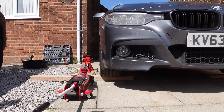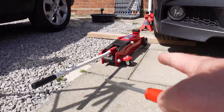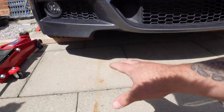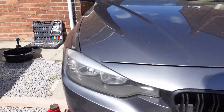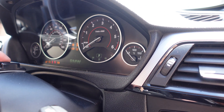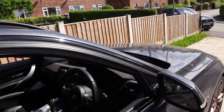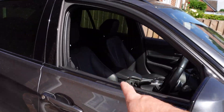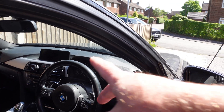I've actually parked the car on some wooden blocks either side simply because if you haven't got a low profile trolley jack like me — I didn't even think about this when I bought it — you might struggle to get it under the front of the car. Just before I started filming I ran the car for about five or ten minutes so you can see our temperature gauge is up a bit. That's just to help the oil drain out easier because if it's a bit warmer it's going to come out a lot easier.